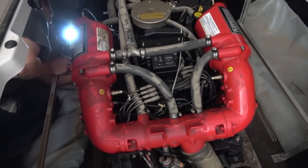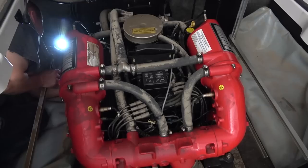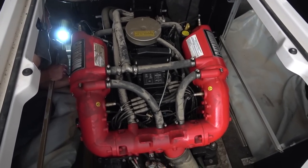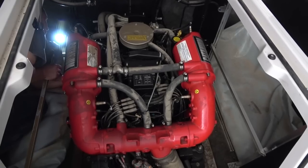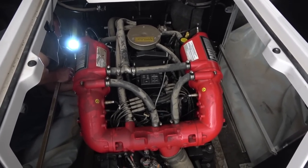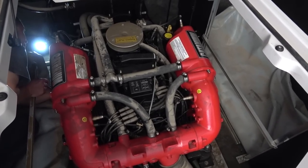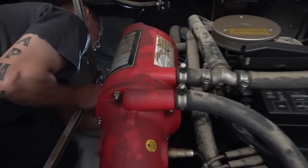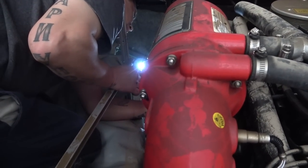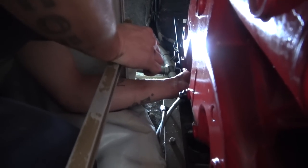After we get the spark plug out, I wanna show you the threads, and then I wanna actually spin the engine and see if it's gonna turn. After that, we're gonna pour in some ATF and let it sit overnight, and then possibly in the next video, this thing is up and running. Of course, if the Linc system decides to turn on. You got that plug? Kind of a tight squeeze in there.